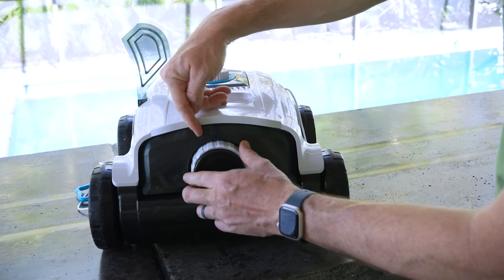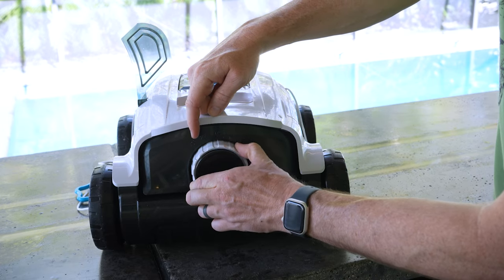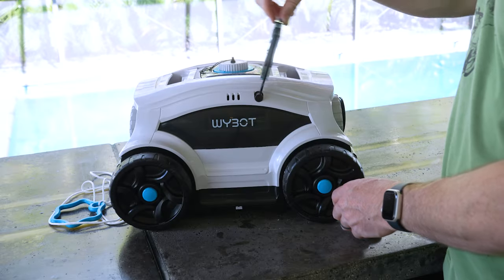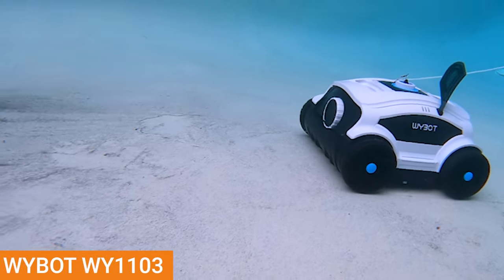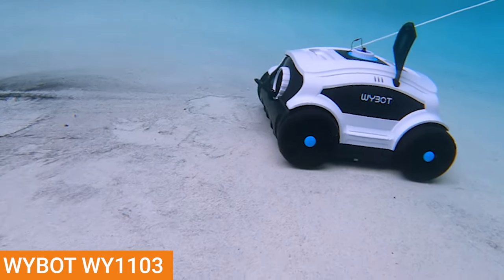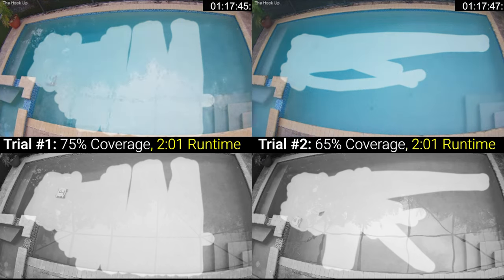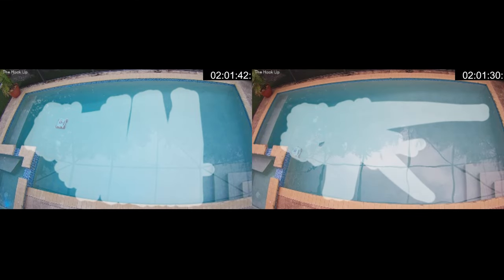The YBOT navigates by using adjustable angle water jets on the front and back of the robot. Using the recommended 0 and 20 degree settings, the YBOT will make a slight turn after each change in direction. The YBOT detects when it's moving using a paddle switch that tilts back as long as the robot is moving forward. But in my pool, the YBOT often got stuck in the deep end because it wasn't able to move fast enough up the pool's incline to keep that paddle switch tilted. In the two testing trials, the YBOT met its advertised two hours of runtime, but only covered roughly 70% of the pool and was not able to navigate walls, ledges, or stairs.